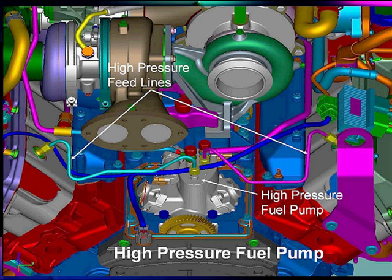The difference now is we're controlling up to 29,000 psi of fuel pressure coming out, going over to the two sides, going to our different sets. So we've got high pressure lines — and even the high pressure lines we need to talk about.